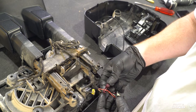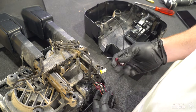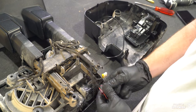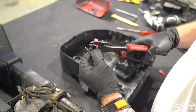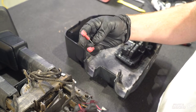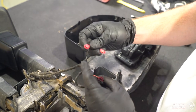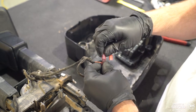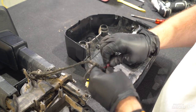We're gonna do that using T-taps. We're gonna put a T-tap on the outside red wire, and then another T-tap on the pink wire on the other end. We're gonna strip the ends of the black and gray wire and crimp on a red male spade connector to the end of both wires. With our spade connectors crimped on, we're gonna insert the gray wire into the T-tap for the red wire. It's very important to make sure that the metal contact in the center gets inserted into the slot on the T-tap, otherwise it's not going to make a connection. The black wire is going to go to the pink wire.